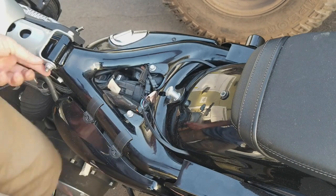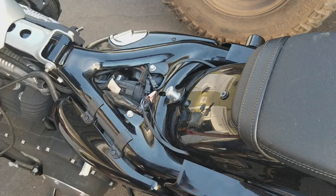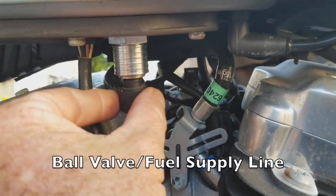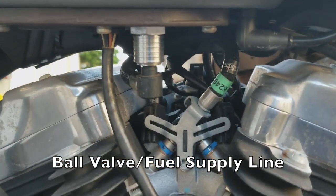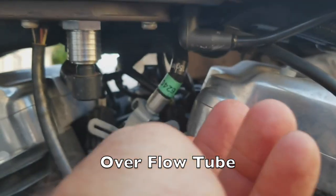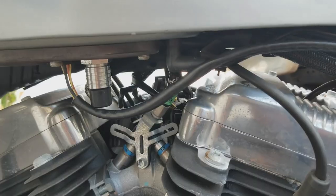And then from there, you do this bolt and your front bolt, and after you disconnect it, that tank's ready to come off. Taking this off, you just push up, pull this down, disconnect it. You will get a little bit of gas, nothing to go crying home to mommy about. Pulling this right out, it's nothing, it just pulls right off when you're ready to disconnect from the bike.